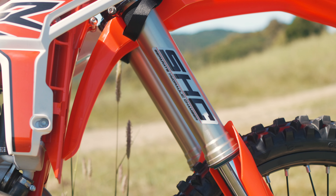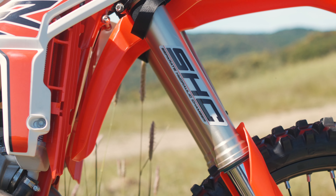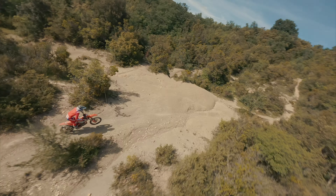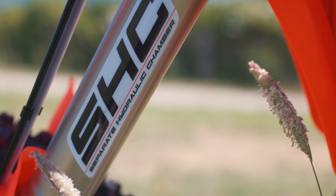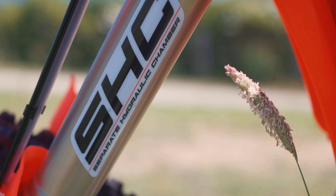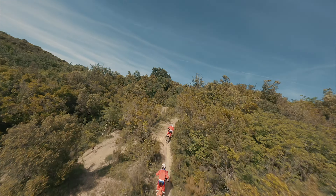The new bike conveys a greater feeling of safety in keeping the high performance of the engine tamed. The new ZF suspension for the RR X-Pro My 2025 has been completely redesigned with an architecture that features a reduced interaxle spacing and travel, changing the bike's behaviour and lowering the overall height by around 20mm. The new fork has been completely redesigned with a new asymmetrical scheme in order to optimise hydraulic operation and reduce the overall weight by around 250g, clearly improving the bike's rideability.